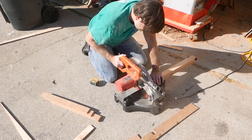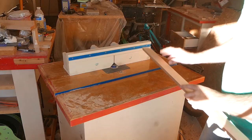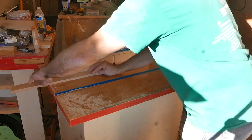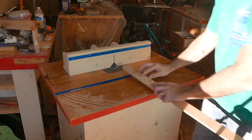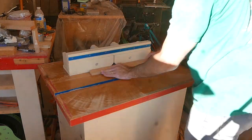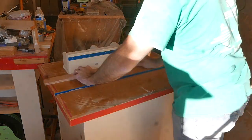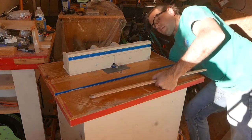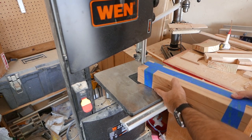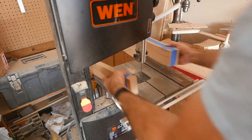The exterior of each window will be framed with 1.5-inch wide strips of 1/2-inch thick plywood, rounding the outer edges for durability and aesthetics. We make and install a hatch for mounting a Maxair ventilation fan on the cabin roof.